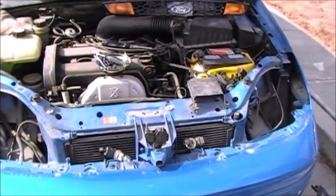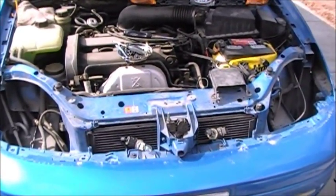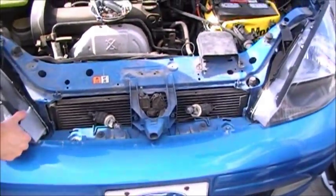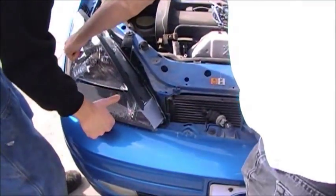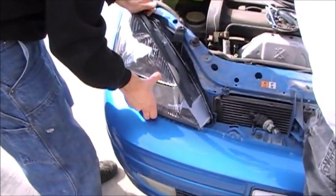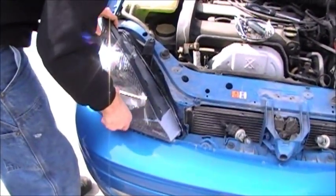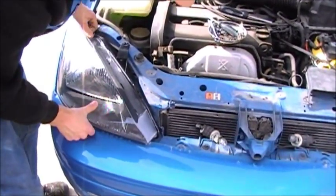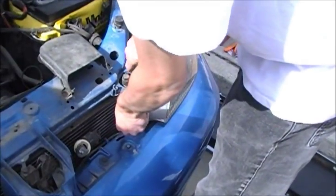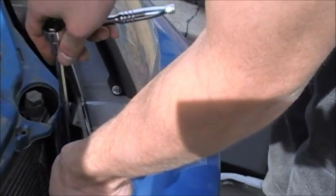Look at what the front end of your Ford Focus looks like with no headlight and grill — it kind of looks like a Skeletor to be honest. First things first, we'll drop the new headlights in place before we can put on the new grill. There's a tab just underneath here that's part of the headlight housing that's kind of dropping into a depression in the core support. So once you get about that far, it'll kind of sit up a little bit. These will probably need to be aimed, but we don't really have the setup to do that.